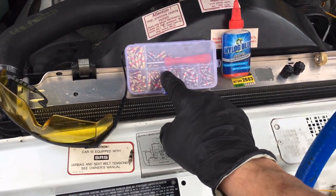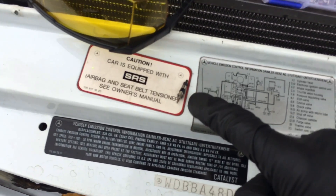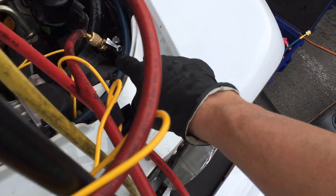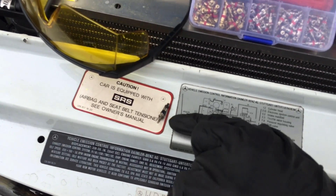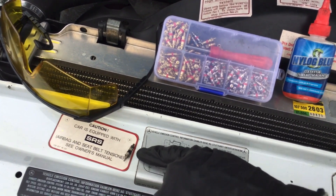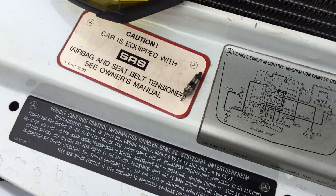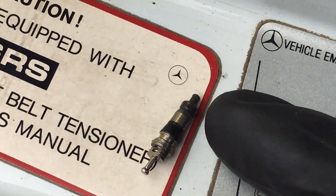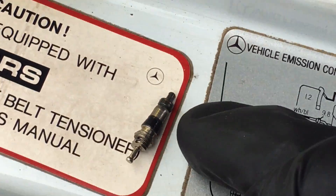Change your service valves every time on old vehicles. Here's something to look at: this is the service valve I took out of the high pressure discharge line from the compressor — at that location from the compressor to the condenser. The body is like chromium or stainless steel, but the actual valve inside is brass. Does that look like brass to you? It's pretty black. That is the part that sits inside the refrigerant flow — it should look like one of those brass ends, not black.